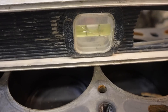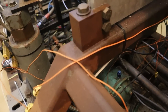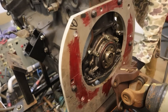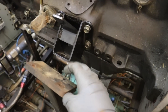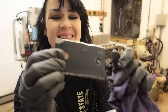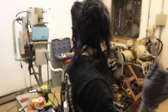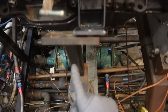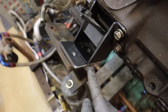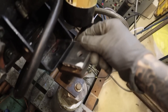I found a pair of adapters for the side mounts in a box of dyno accessories that fit almost perfectly. We just need to fabricate some adapters. We got our plate attached, and now we've got to adjust these side pieces to hold these motor mounts. Charlie and I just made some adapter plates, and these are going to go in between the Supra stock motor mount and this plate for the dyno. We've got this one here already, and this one I just finished is going to be for the other side.